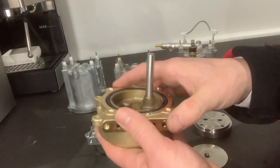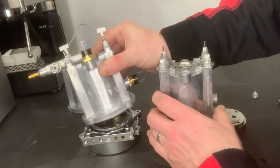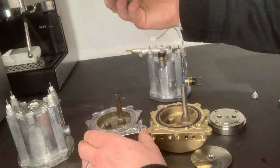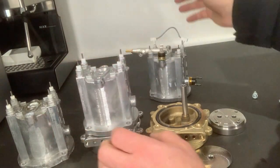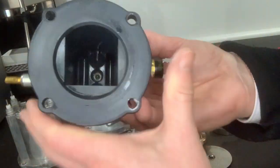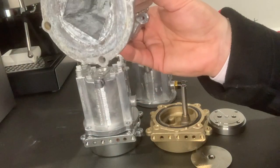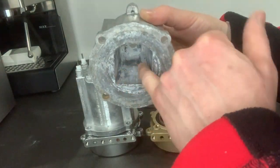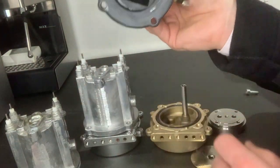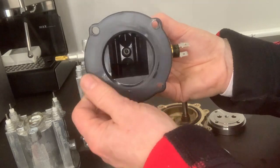The size of the boiler is identical — the same shape — so they can be interchanged pretty easily. The new boiler has a non-stick coating that's meant to last a lot longer, and hopefully limescale will not stick to it, unlike the old ones. As you can see on a previous one I've cleaned out, getting the scale off is pretty hard. In tests Gaggia made, the new one is far, far superior — far longer lasting and far more protective inside the boiler.